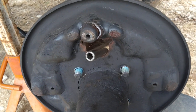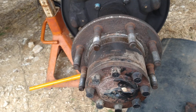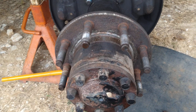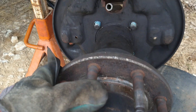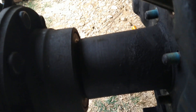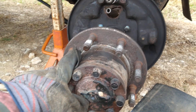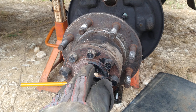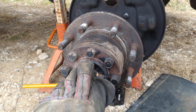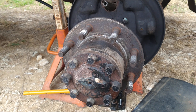As you can see, I was a little out of my head and I took the mounting bolts off even though I still have a hub on here. As far as I know, I don't have a spare wheel seal underneath the back seat for this, and as long as that seal's not leaking, I really don't want that extra labor. It's almost noon already, and as far as I know I do have the appropriate socket for the nuts in here, because I know I've had to do a wheel seal on this before.